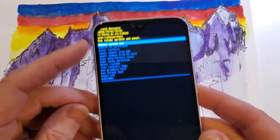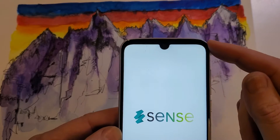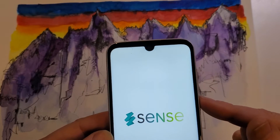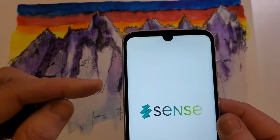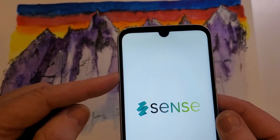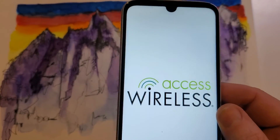Look down here for the data wipe being complete — now it's safe to reboot the system. Keep in mind we've only erased the screen lock. If you used your Google or Gmail account on this phone, especially if you turned on Find My Device or Locate My Phone, you will still 100% need to enter your Google account login to get back into this phone, even though we've just erased everything. Keep that in mind when you factory reset your device.